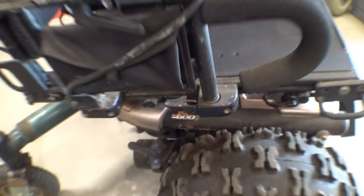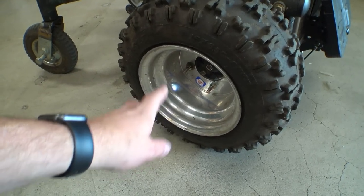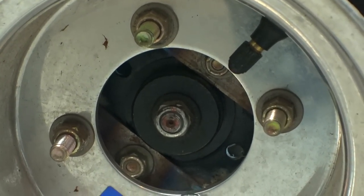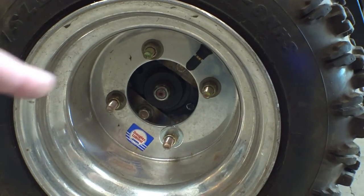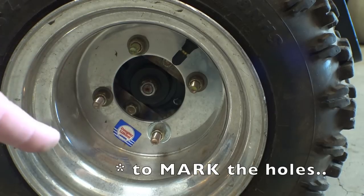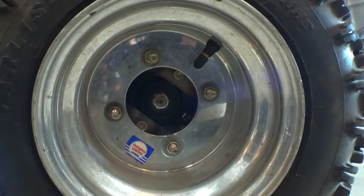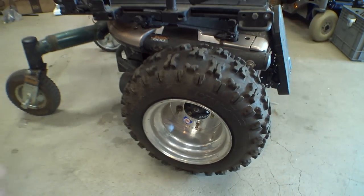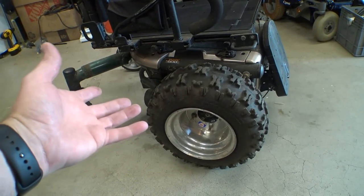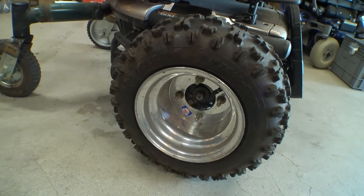It was a Jazzy 600 with some Quantum logos. Basically, I found some Douglas Blue Label ATV wheels on Craigslist with the tires on them — they're pretty wide. For adapters, I got four pieces of flat bar, laid two across like this and two more across like this, used a center punch to punch out two holes, drilled the other four, laid them over the top of each other, and tack welded them together. So we really only have two bolts holding this entire wheel arrangement onto the motor hub. For low speed, non-daily use, it seemed to work fine. Finding wheel adapters to go from power chair hubs to a bigger size like this — yeah, those don't really exist.